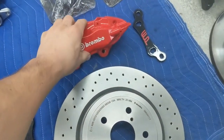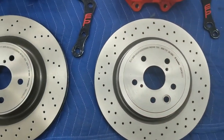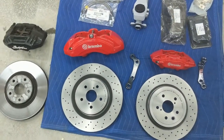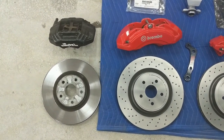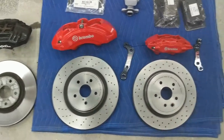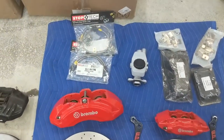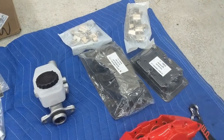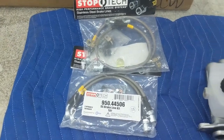When you combine those with his adapters and the Lexus LS430 rotors, it's kind of a bolt-on affair. You do have to modify the dust shields and do a little bit of grinding on the caliper, but aside from that it's bolt-on. You can see how much more massive they are than the stock rotors and calipers — there's the front, and here's the rear. He sells a complete kit with rotors, calipers, his adapters, brake pads, clips, pins, and stainless steel braided lines made by StopTech.